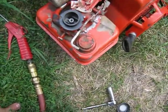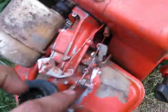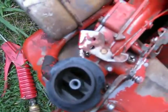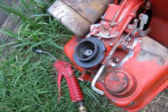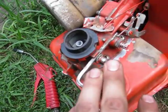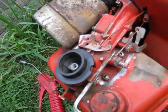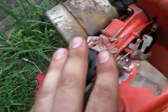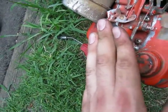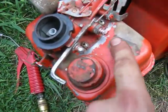To summarize: it needs a new carburetor base gasket, which goes around the base on the gas tank with the three Phillips screws. That's my guess because it's pulling air back up through — when I capped this off, it created more of a vacuum. So I think it's transferring fuel back through, and the air is escaping through the gasket in the tank, affecting the air-fuel ratio.